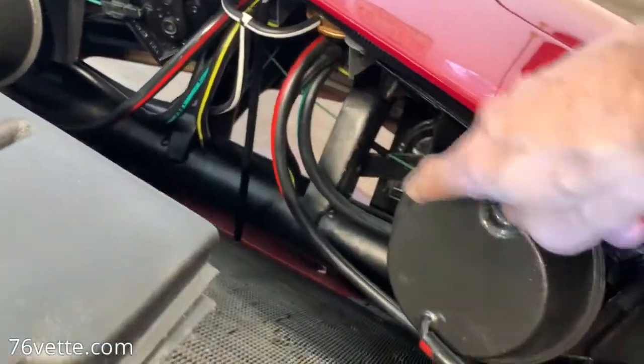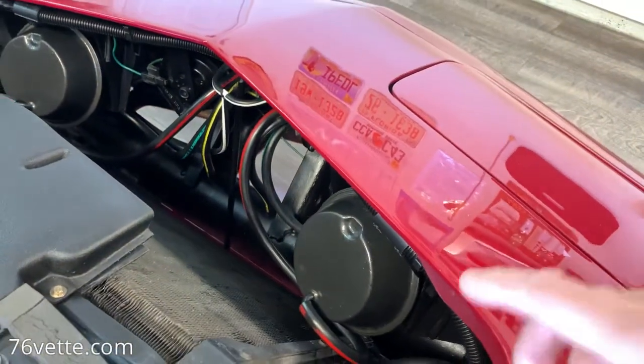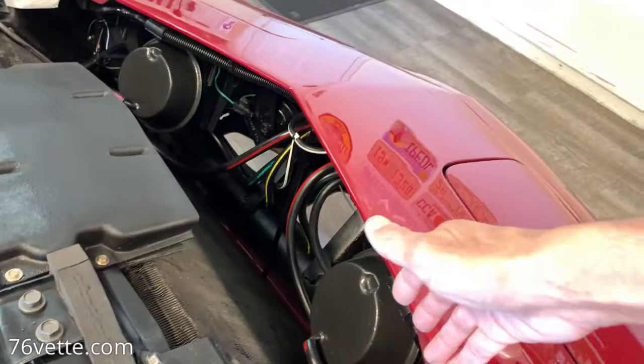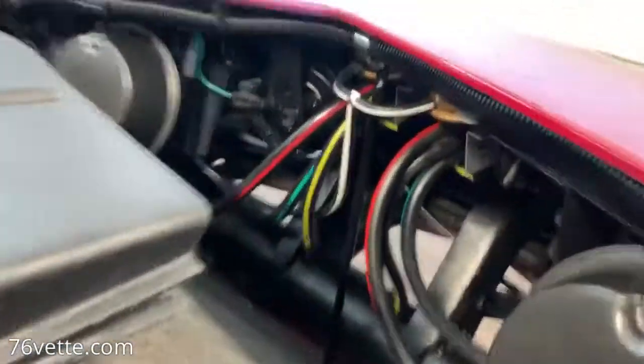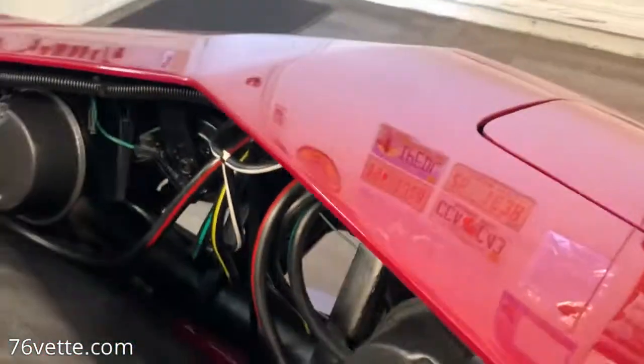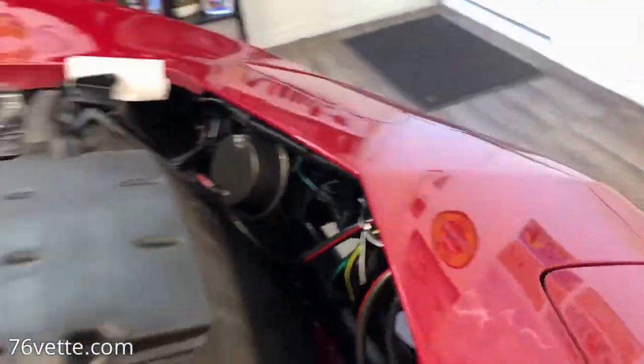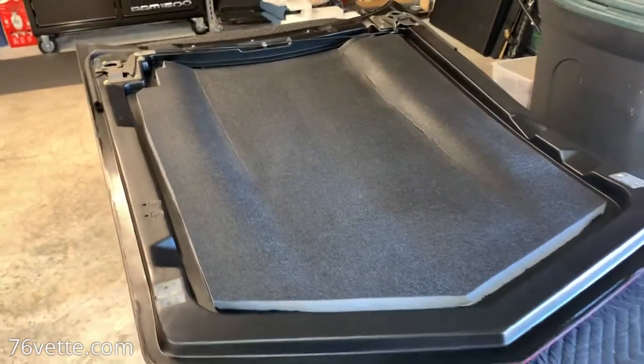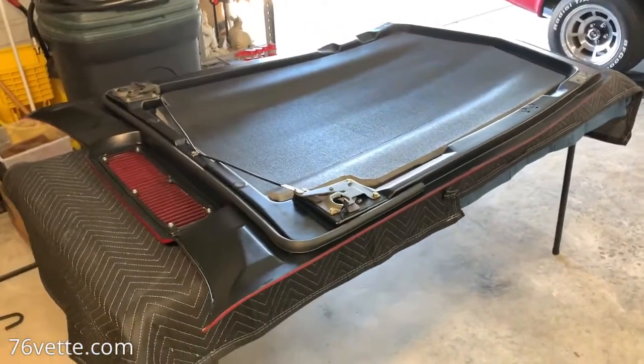I also detailed the horns and replaced all the vacuum hoses, since this was the time to do it. I repainted and insulated with Dupli-Color truck bed liner — brushed it on, removed the actuator cans, and all the wiring came off again so I could detail as much as possible. I also have the FatMat liner ready. It's about three-quarters of an inch thick, self-adhesive, though it is a pain to install — especially working alone.